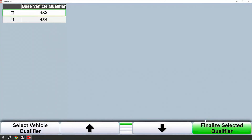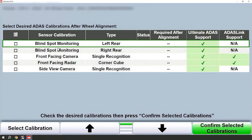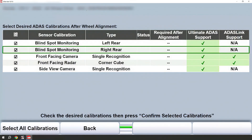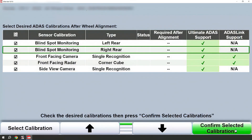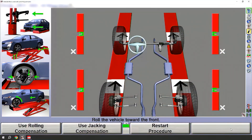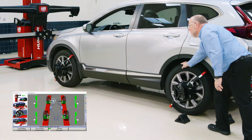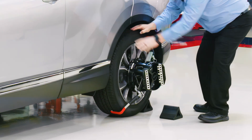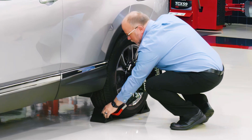To progress we will need to add a qualifier here — we need to know if this is a four-wheel drive or a two-wheel drive. I'll choose the appropriate four-wheel drive model for this process. With this screen we will choose what ADAS calibrations we need to do. We can either check those individually or drop down one row on the menu and select all. Returning to the top menu and confirming those calibrations, we're now ready to compensate the vehicle. Once the vehicle is compensated, be sure to chock the wheels so the vehicle doesn't move at any time during the procedures.